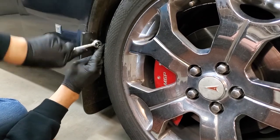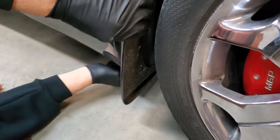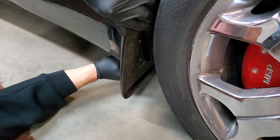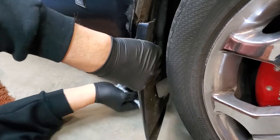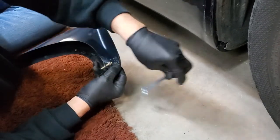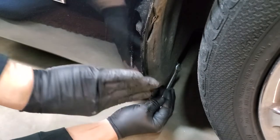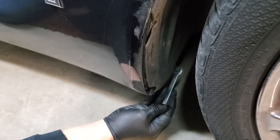We'll start them and take them out by hand. Underneath you have one more bolt — this one's a 10 millimeter. I'm going to have to do it by hand with a little wrench to take the splash guard off. Now it's out. Here's the number 10 wrench. We have another seven millimeter you have to take out as well. If you had the splash guard, you want that out first; now you've got to take this one out with your seven millimeter.